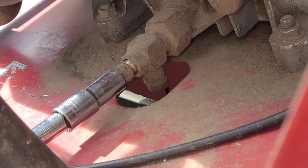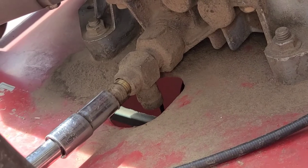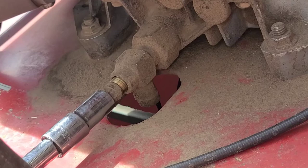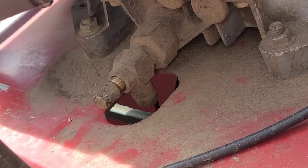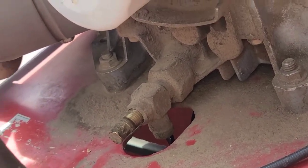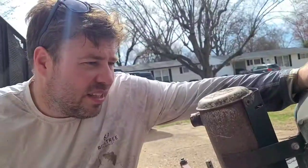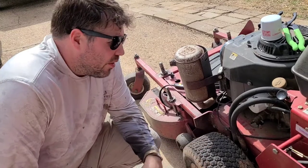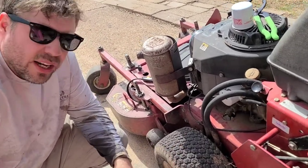Just now starting, very slowly. Can you see the oil? There we go. It's always kind of slow at this. You sit here and let it drain. I believe it takes — it's 1.8 quarts for this engine. It's still draining, so we're gonna have a few minutes.